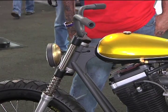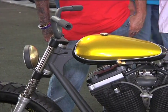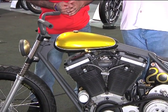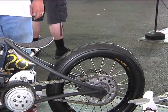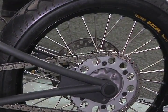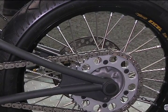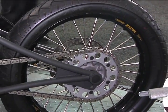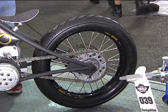I can tell you really did take a lot out of the 70s motocross — that was a pretty interesting time for racing. What about brakes? We've got a two-piston JB caliper in the back — it's plenty of power to stop a 300 pound bike. I use motocross wheels; the hubs and the rims are all from the CRF 450. All the brackets and rotor mounts were machined down. They're super durable and super lightweight. These guys are jumping 350 feet, 60 feet in the air, and this is what they're using — so if it can take that abuse, it can definitely stand up to my abuse.